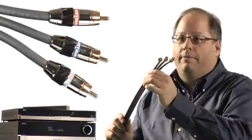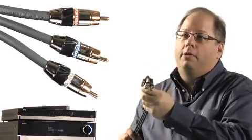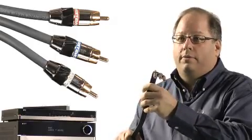There are going to be some instances where HDMI is not going to be the cable of choice. Sure, it's the cable that everybody knows about for digital high definition, but there is another high definition cable connection available, and that's component video. Component video carries all the different signals and is most commonly used with high definition converter boxes and DVRs. There are plenty of products in our houses today that still don't deliver high definition, and for those products we'll use a composite cable to deliver video directly to the back of the AVR.